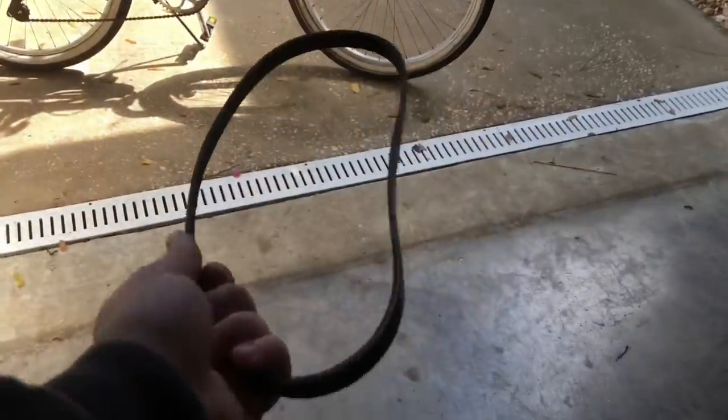I'm gonna be putting an OEM Honda filter, which I run on the Integra. Even a lot of the sport front wheel drive guys run OEM Honda filters. It's an OEM part that works well, and people like to use OEM things. I like to use OEM things as well. Without further ado, I'll give it another start, let it idle for a bit, raise the idle a little bit, like 2000, so it can get all the oil where it needs to be, and then we'll drain out all that old fluid. So here is the alternator belt that I'm gonna go return or exchange right now.